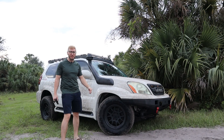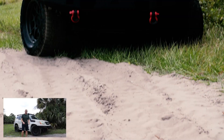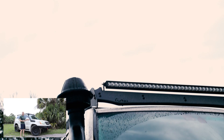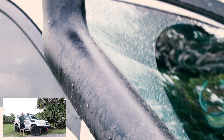So there we have it — the snorkel install is complete. We've come back out to the area where Max and I were a couple of vlogs ago, and now we have a snorkel and our rear diff breather. We went through a lot of the puddles we avoided last time and we do not have any water in our airbox — snorkel is working as expected. I'm a big fan of this topper, the pre-cleaner is working really well. As we went through some puddles, water hit up in this area quite a bit — there's water all over the top and even some mud in the reservoir, which probably would have gone inside if we had the other snorkel top on. Great to see the benefits of the pre-cleaner already.